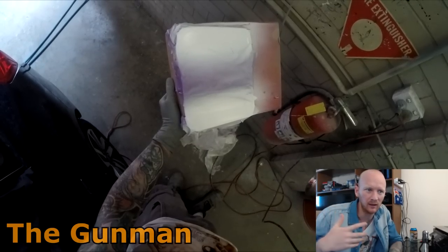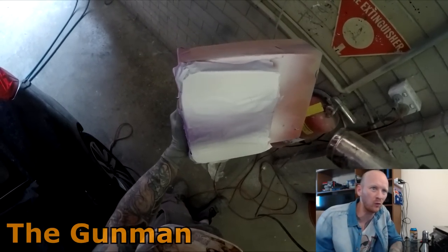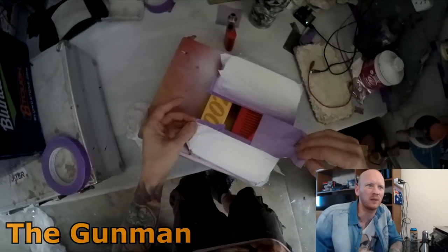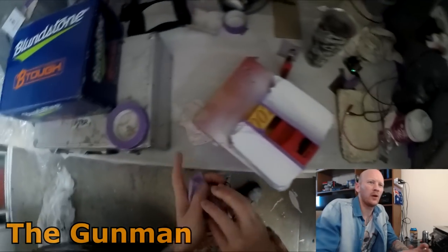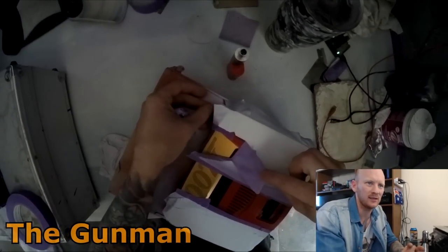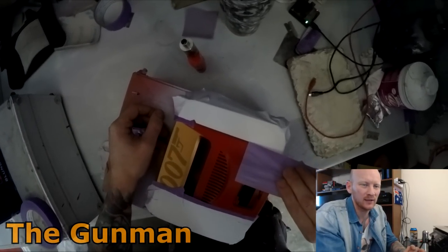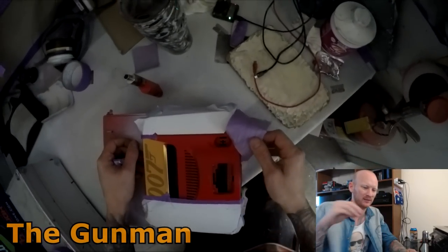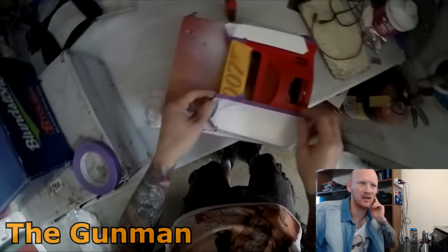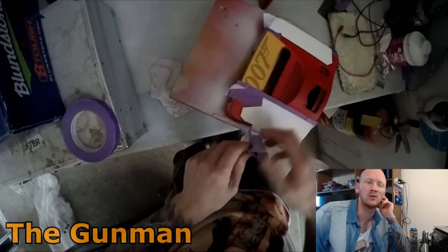So I'm just using that heat gun again. Like, I'm just doing this base coat stage in the workshop. The booths were both full. And for base coat, yeah, it's such a small section of base coat, you're going to be pretty safe. So here we are putting our plastic primer and primer adhesion levels to the test. And as you can see, it definitely passed because, yeah, the last thing that you want to do is go and peel your masking off and have all your primer and stuff peel off with it. As you can see, that was not the case. So the methods are sound and they do work.